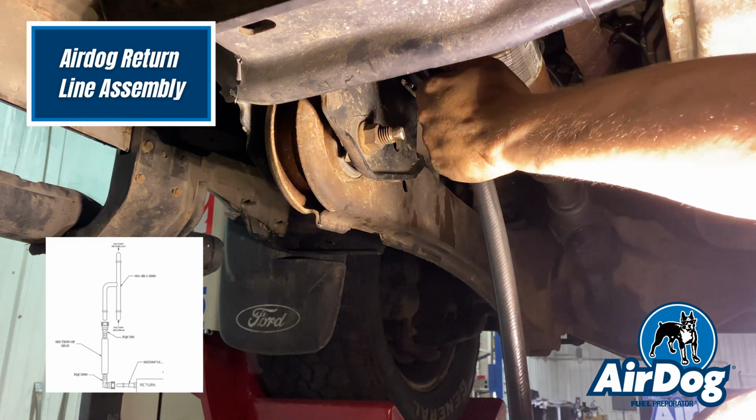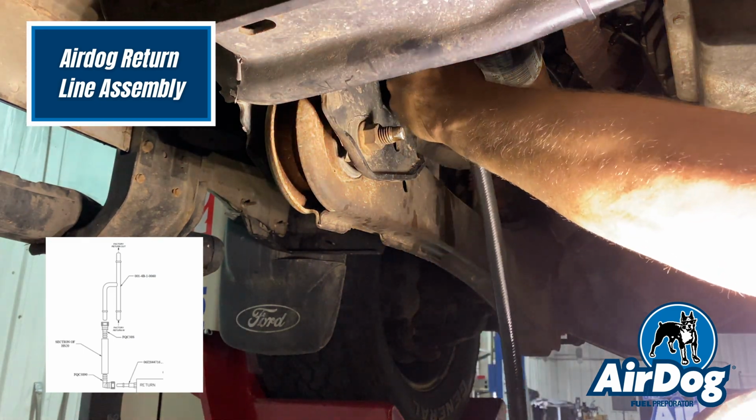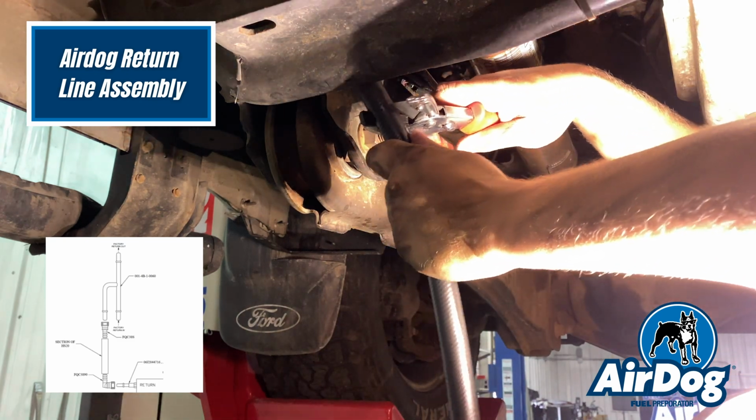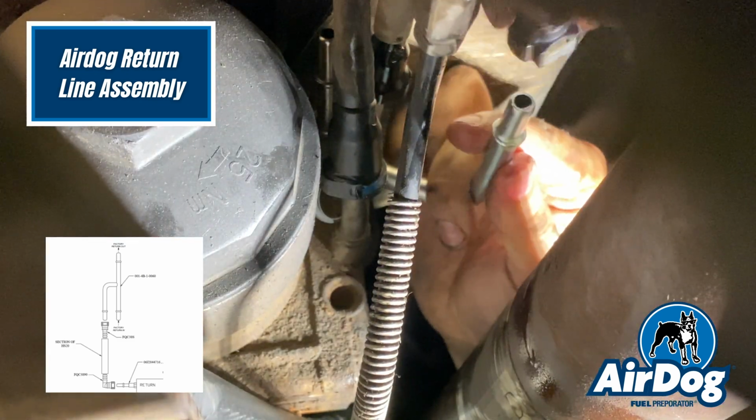So now that we've routed the hose up to your return Y, we've determined the length we need for the Airdog hose. I'm going to go ahead and get that cut and get a 3/8 straight quick connect pressed in.